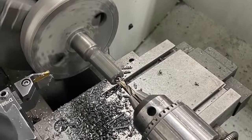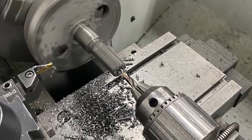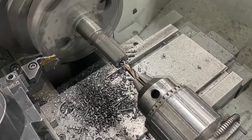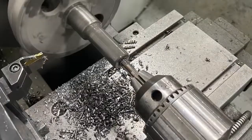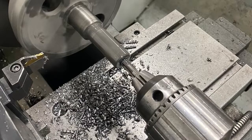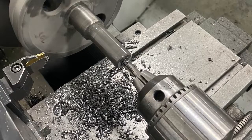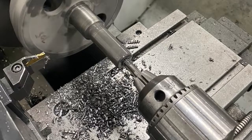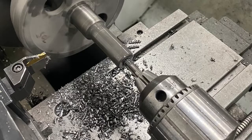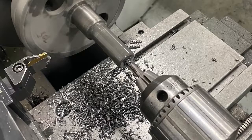While it has a slot in there to hold your gear, there's nothing there to prevent that from loosening up and walking off the shaft. This has been a problem with these quarter midgets for a long time — if the bolts come loose, the gear hub walks off and you lose your chain and sprocket. Here we are tapping the hole. You can make a large washer or use a standard store-bought washer with a bolt, tighten it right into the end, and if your hub comes loose it's not coming off, and that will save your race.